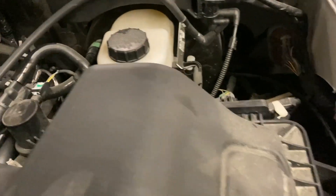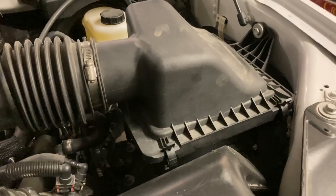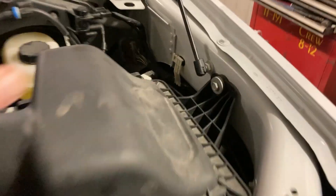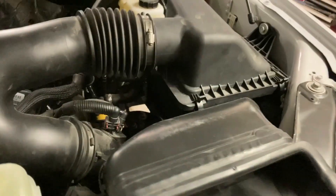I'm going to show you how easy it is to install a K&N box filter, which will give you more flow whether you do my intake mod or not. I cut a larger hole on the dirty side of the air filter box. Never make any cuts up here — just the one right where the air source is. You can cut additional holes down on the bottom like I showed you in the last video.